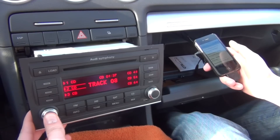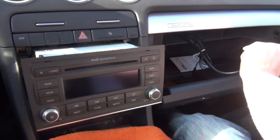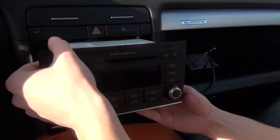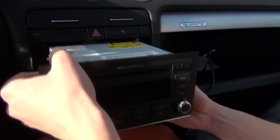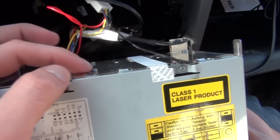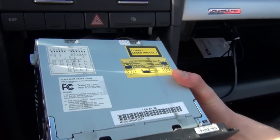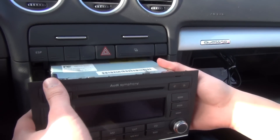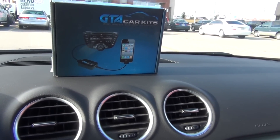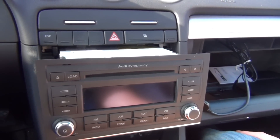Make sure there's enough space to tuck in the module behind the radio. The most important part is to put in the ground properly and screw it into one of these — even here on top works, but we suggest putting it in the back for the ground. After you've done all of that, tested it, and made sure that everything plays through all the speakers, you can enjoy your GTA car kit in your Audi A4, S4, and any Audis with this type of radio. Hope you liked our video and we'll see you next time.